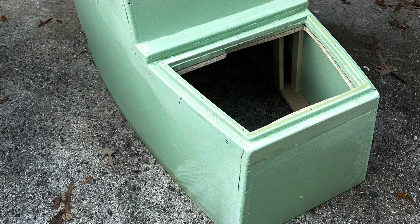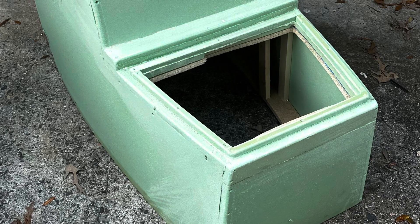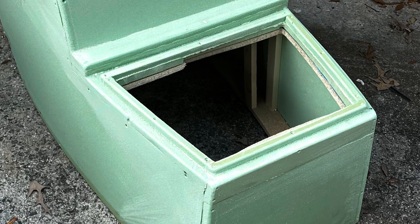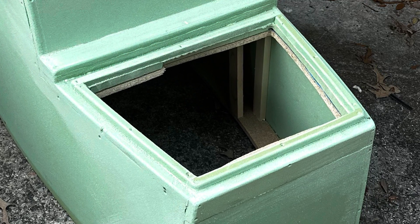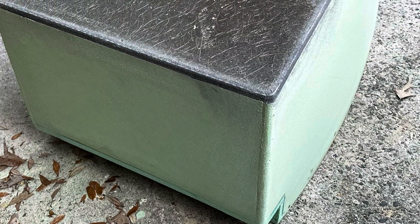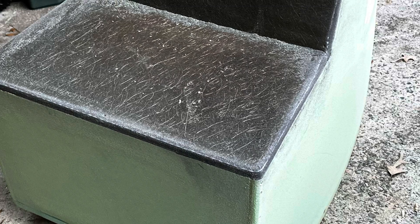You'll see I did start building a little gutter system — I'm raising the interior edge of that front area. I'm going to make this front area a double-insulated cooler, possibly a live well. You can pretty easily make a lip with foam. Here's another shot of the back with the Coosa. You'll see I'm starting to round over my edges — I took a router to the edges and did a half-inch radius all along them, because with the mat and cloth I'm going to be using I do need a good radius.